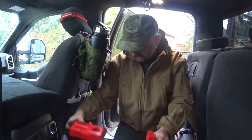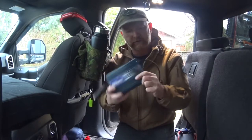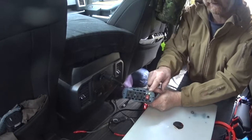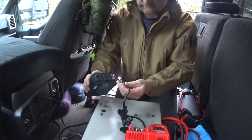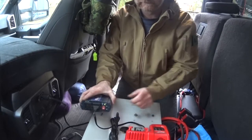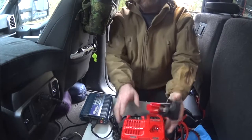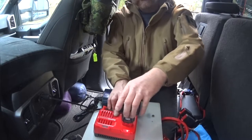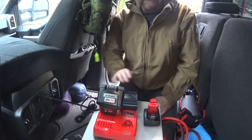Then I came up with another idea. I have a portable 12-volt, 300-watt, 30-amp, 110-volt inverter. If I plug it into the cigar lighter of the vehicle and turn it on, I get a green light, the fan is on, it is working. Now if I plug in the Milwaukee charger, turn it on, we have a green light, the fan is running — and let's try plugging in the 12-volt battery. Straight away we've got power and charge. If we plug in the big 12 amp-hour battery, we have charge. This is now a fix. The LED will change to flashing green when nearly full and solid green when full. It's a smart charger and can charge both batteries sequentially — once the first is full it moves to the second. About an hour to charge the battery on its own.